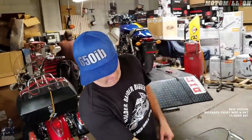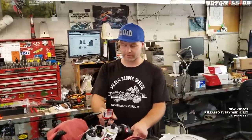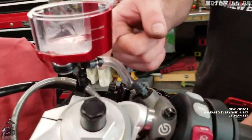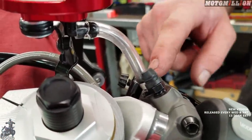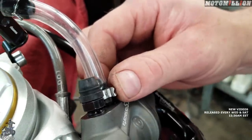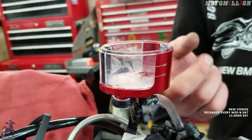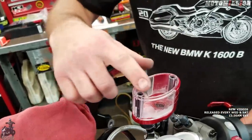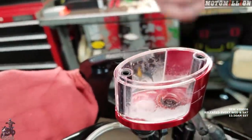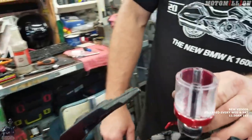Next step: insert the fitting into the master cylinder reservoir and connect the hose between the two. The Tygon hose is cut to the perfect length so there are no kinks — just a nice arch. Manny at Moto Million supplied really nice clamps; you can supposedly find them at a hydraulic store. One note: this end I safety-wired because I made a mistake — the fitting was super hard to get into the reservoir so I sprayed silicone on it, then tried to wash it off with brake cleaner, not realizing the reservoir is plastic, not glass. It etched the plastic and left a white film inside.